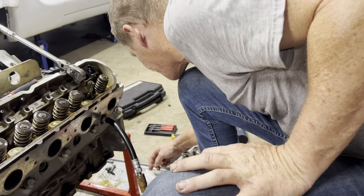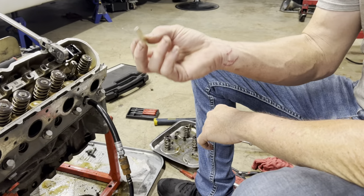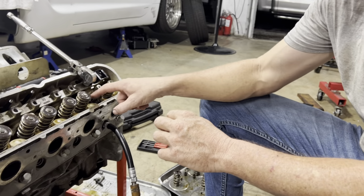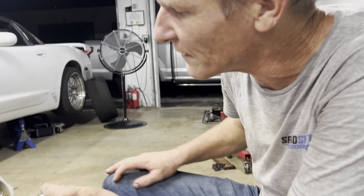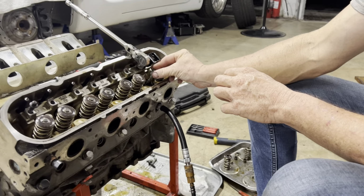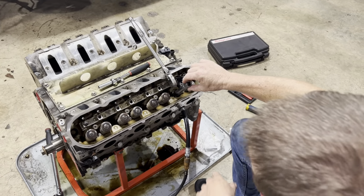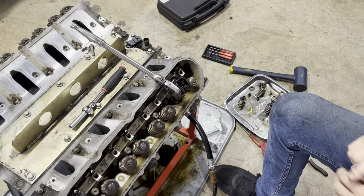And then we have this little protective sleeve. This protective sleeve goes down over the valve stem and it protects the valve stem seal from getting hurt by the notch in the valve stem for the keepers. Let me just push down nice and easy. And once it's down, I got this awesome little socket, 9/16 deep with a half inch of reducer up top. Let me just push down straight and it goes right down and that's it.